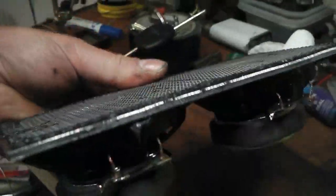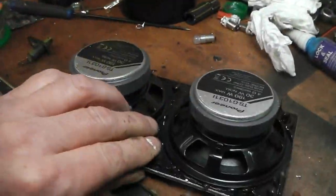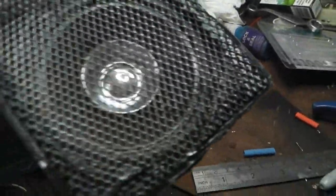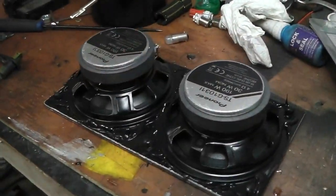Then this offers up into the centre console. That's your double speaker. It just fits in, I've measured it all. So we need to fit that. Again, this is Tiger Sealed into the centre console. Sounds crazy, but it creates an air seal so that the full sound wave goes through and it doesn't rattle. And these are pretty fit for life speakers.